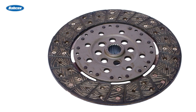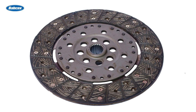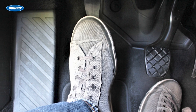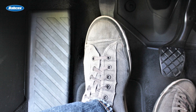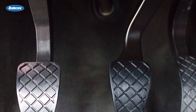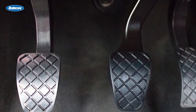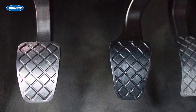The friction disc is sandwiched in between the two, and it's the friction disc that is splined to the input shaft of the transmission. When the clutch is engaged, the diaphragm spring applies force to the pressure plate to tightly grip the friction disc between it and the flywheel, so the power of the engine flows into the transmission. When the clutch is disengaged, a throwout bearing pushes on the center of the diaphragm spring, causing it to pull the pressure plate away from the friction disc, letting it slip freely so no power flows into the transmission.